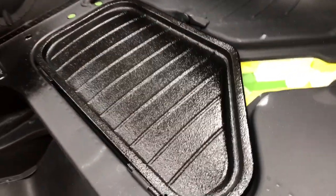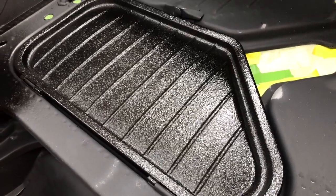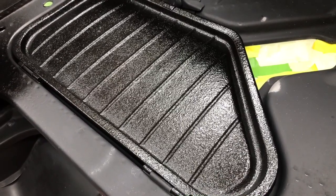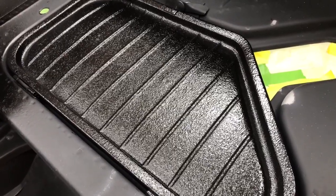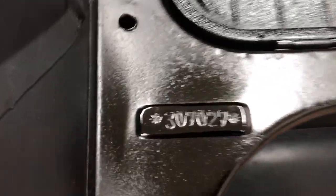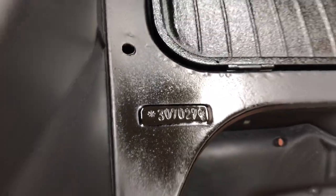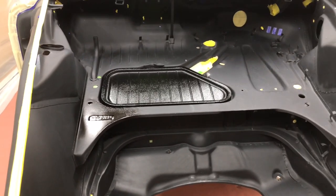Here's a sampling of what it's going to look like. I did this a few days ago and we got a clear coat on there. That's a 75-25 blend with our 2060 and our 2021 to get that sheen — kind of an eggshell type finish. I think that'll look real nice when we're all done. I also just painted the VIN numbers in a real nice black. I'm going to tape those off, shoot my undercoating on everything around it, and then peel the tape when I get ready to do my clear coat, which should bring those up real nice.